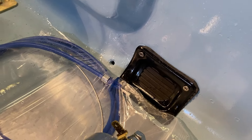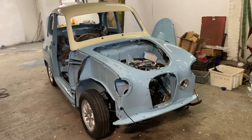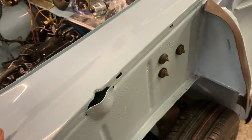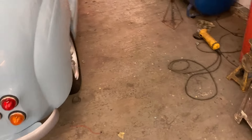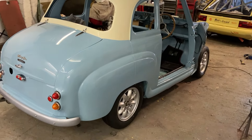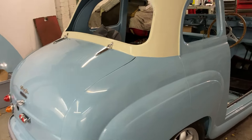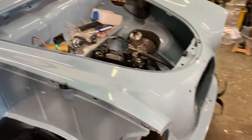I made that little seal there — another little job. Well, the A35 is on its feet at last! It's sitting there nicely. It's pretty firm — difficult to show that on film but there's not a lot of movement in it. This is going to handle like a go-kart, but I can always back the shocks off because I don't really know what setting the car will want until I drive it. The back is definitely going to come down a little bit — it's about half to three-quarter of an inch too high at the moment. But it will come down — it's coming together well.